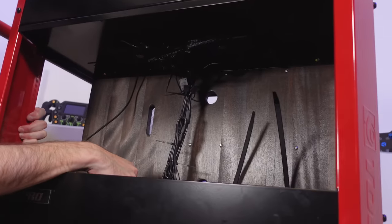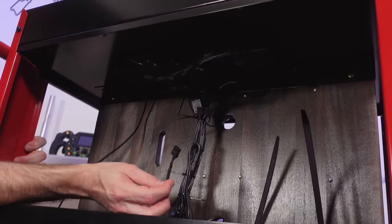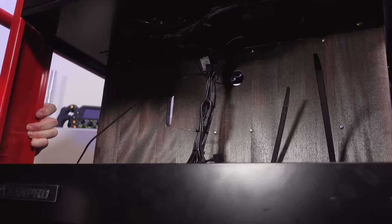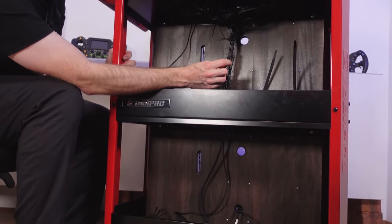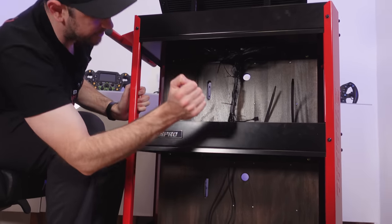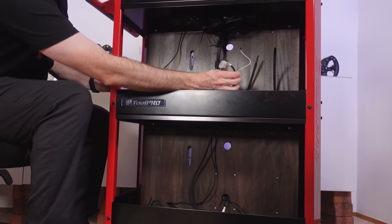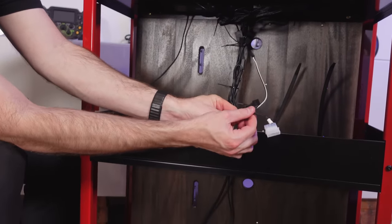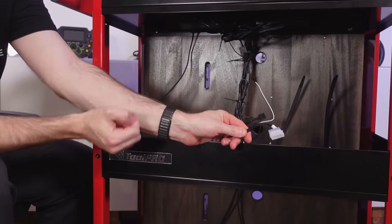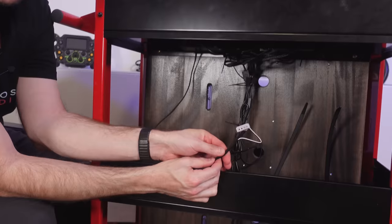I've also got to extend some of the wiring to get from the bottom PC up to the top. The next thing I've got to do is actually extend this USB header so that it's long enough to reach down the bottom. I've already created our power connections for our power buttons — that's the 12 volt power which runs to the LED in the power button. I actually did a video guide about a year and a half ago on this and I'll link it in the description.